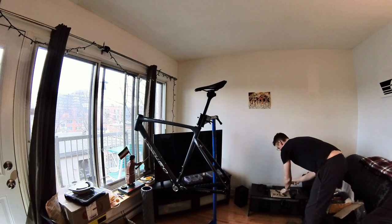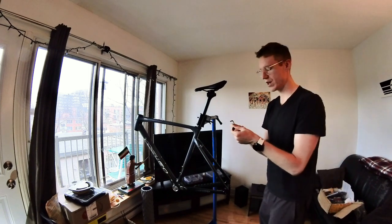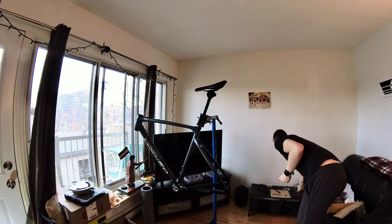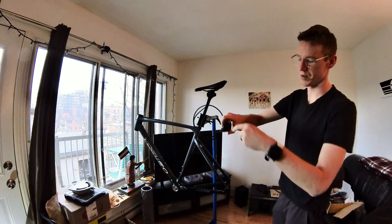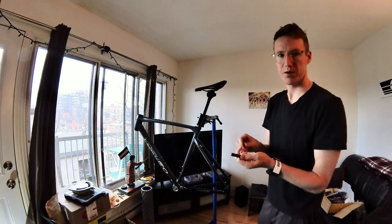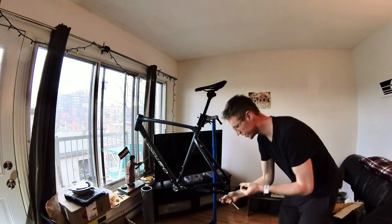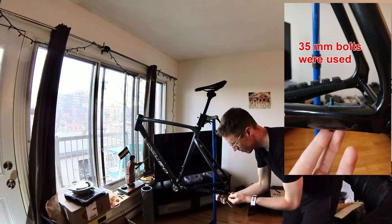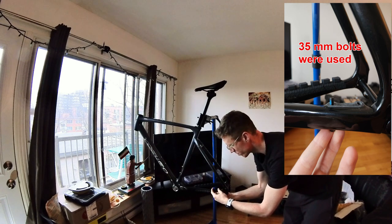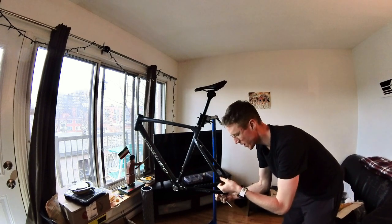We can wrap the mount on. If you have a Shimano-style brake you'd have to screw the brake onto this first, because for flat mount or post mount all the screws come from the top, so we can put these on after. You get a bag with a bunch of hardware including a whole bunch of bolts. You basically want to select the bolt for the back that is long enough to go through the frame from the bottom side but will fully thread into the caliper — you don't want it too short, and you don't want it too long otherwise it might impact the ability for the brake to fit onto this kind of mount.